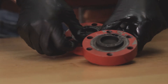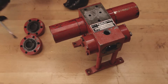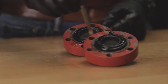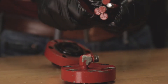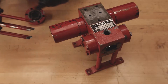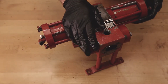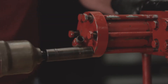Install the cylinder head o-rings and lubricate them with oil. Place the bolts into the cylinder head and mount it on the cylinder. Make sure that the tubing fitting is in the right place and tighten the bolts in a star pattern, just like you would the lug nuts on a wheel.